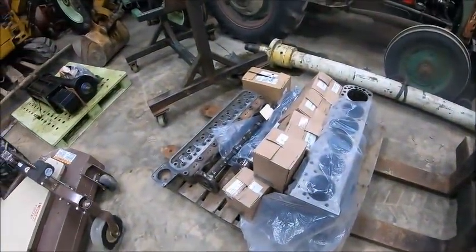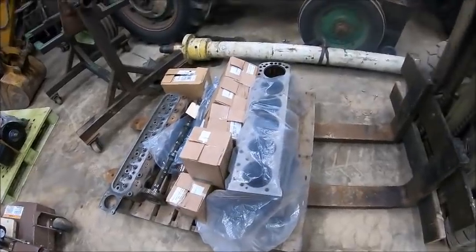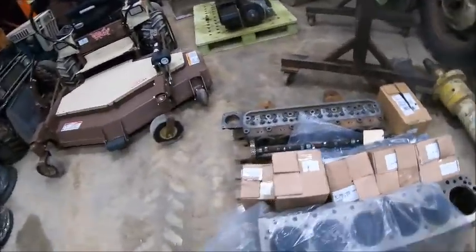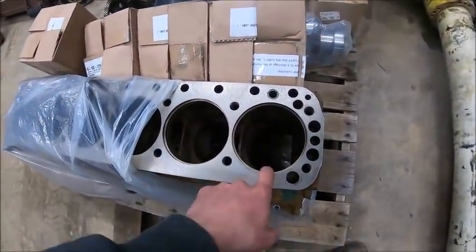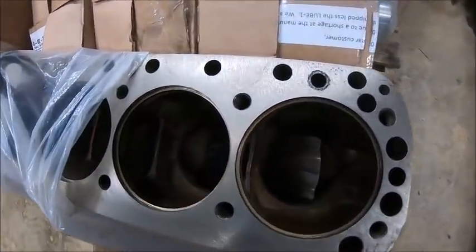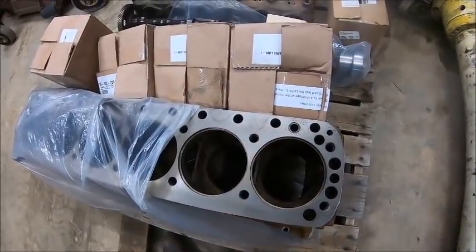All right. Well, we finally have all my engine parts back. Now I guess we'll start with the block. They decked it, recut the counterbores, honed, did a really light hone on the lower sleeve landing where the O-rings sit.